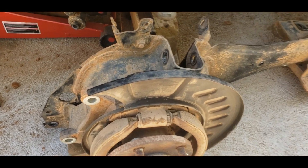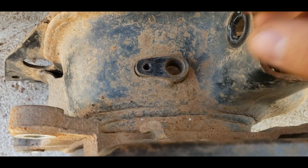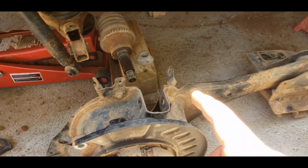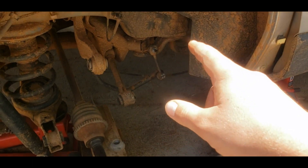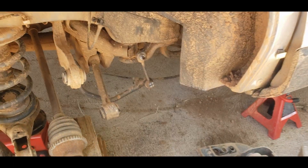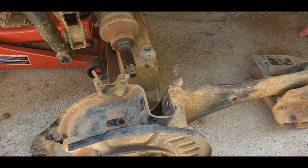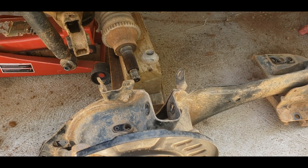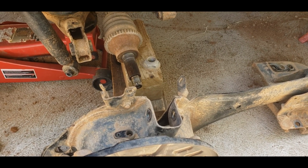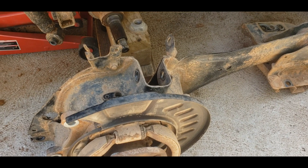The parking brake cable is right here — the best way to do it: take a wrench or something and shove it back and maneuver it off. I advise taking the cable loose — it acts as a washer on that piece, and it also goes back underneath and bolts in. Take all that loose first and then come and disconnect it, because that gives you some slack you can work with to get it off. You've got to have the Torx bit, the big socket to get the axle nut off, and get the lugs off.